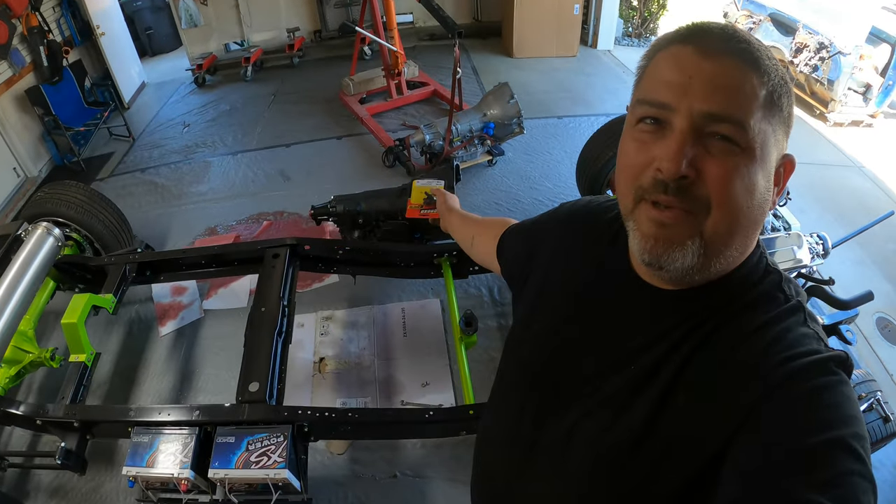It's about a three-and-a-half hour drive one way from my house to Reno, Nevada — so not only did I have problem parts, I had a long drive ahead. I also spilled transmission fluid all over my garage when I had to pull the transmission back off the motor. Summit Racing got me fixed up and I ended up getting a TCI torque converter, part number TCI-242900, with a stall speed of 2,000 RPM, somewhere in the neighborhood of $600.